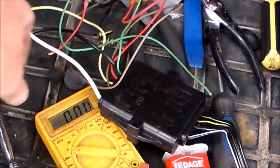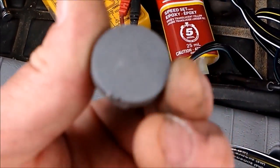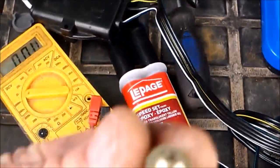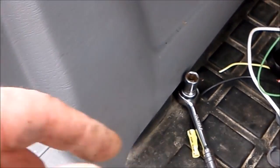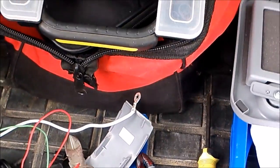You'll take out the three rubber or plastic plugs on this side of the trim panel on the bottom of the passenger compartment or tailgate area. Three Phillips screws — take them out — and one Phillips screw in the cargo hook, pull that out. Then you have to pull this away. You might as well take this off, prying from the top only using a plastic tool, pull it out halfway and then slide it up.